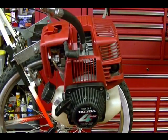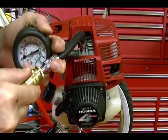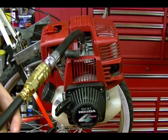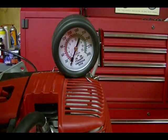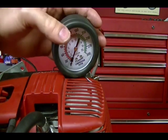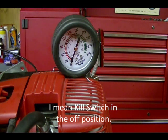If you've got a two-piece compression gauge, attach your gauge. I've got the compression gauge attached to the engine and kind of wire-tied it here just to hold it in place. Also make sure that your kill switch is in the off position. I'm going to pull the cord 12 times and I'm going to leave the throttle completely closed.